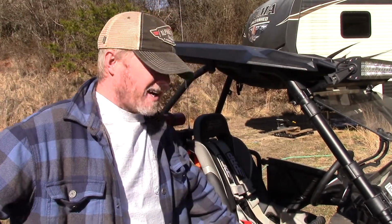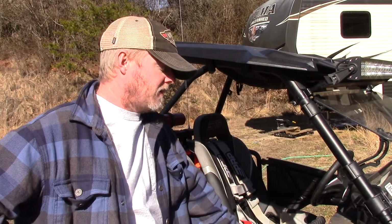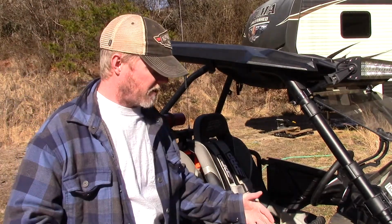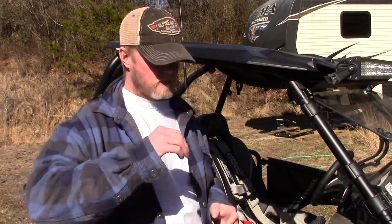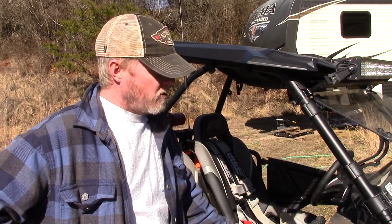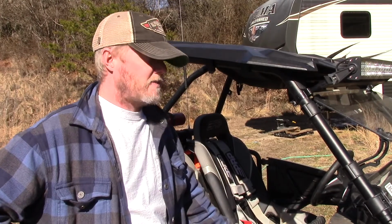And it may not get you that day, but it's going to cause a belt failure in the future. And the best way I know to describe it, if you're sitting in the RZR on flat ground, obviously you don't really want to super ease into it. You actually want to mash the throttle a little bit and get it started and get it moving. Once you're moving, the belt's engaged and you have engine braking. What you don't want to do is hesitate and maybe just cover the throttle just a little bit, and definitely never use it as a brake.